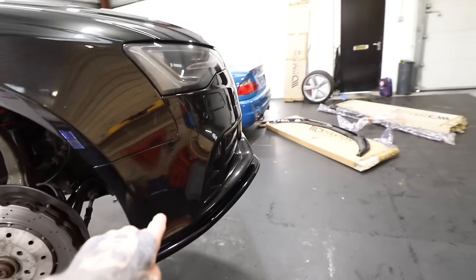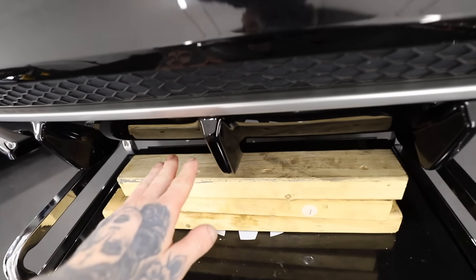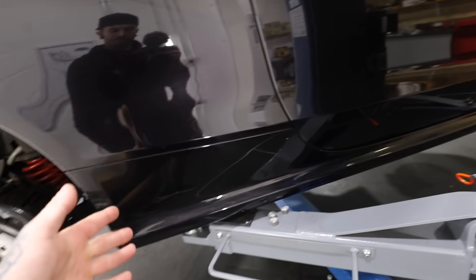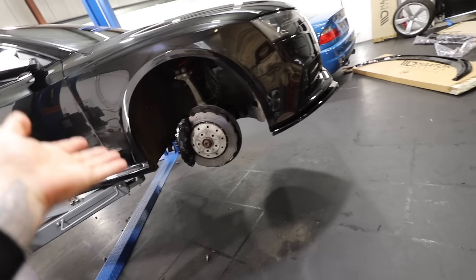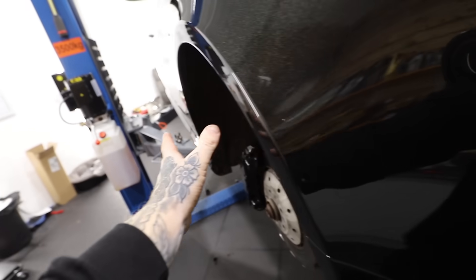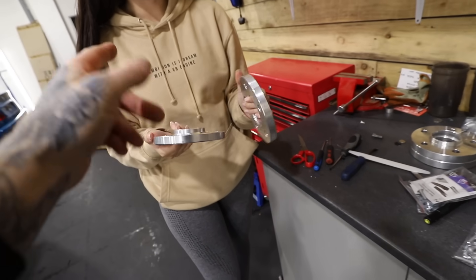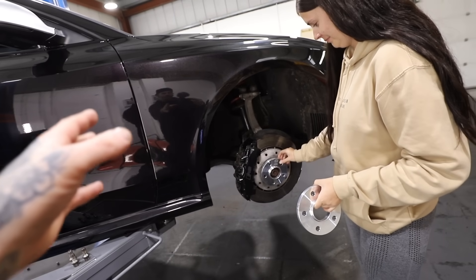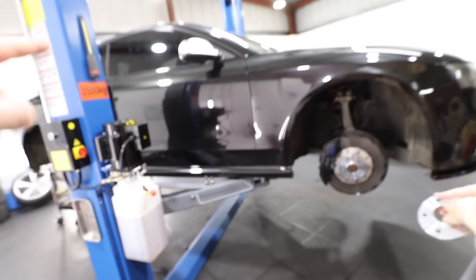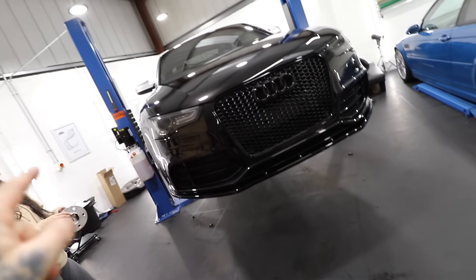We've got the front splitter on — that is looking nice, a great addition to the front bumper. The rear spats are on, we've got a more aggressive rear diffuser with the glue setting, and side skirt extensions to go on once the car is off the ramp. Now is the time for the wheels to go on. The standard wheels sit way far in the arch, so Hannah has a fix for that — wheel spacers. There's a link in the description. We're going 15mm on the front and 20mm on the rear, which worked best when we had the S5. Pop them on with longer wheel nuts, lower it down, jack it up and get the side skirt extensions on.